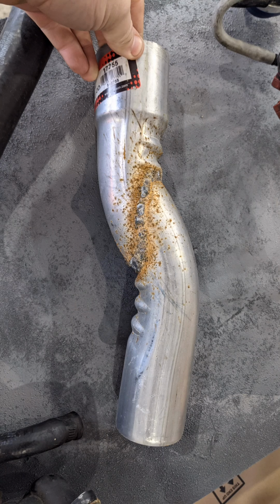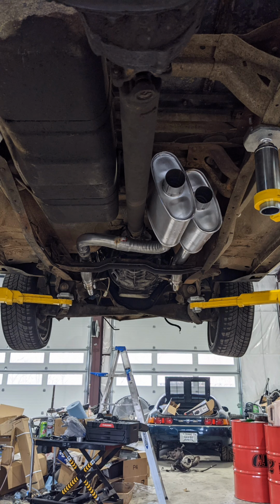All right, so I had to make some of these dog legs because the headers run straight into the crossmember. Just kind of tucks it up and over. Do a temporary exhaust for now. Once I get my suspension done, I'll get it all laid out super nice when I move the fuel tank and whatnot. So these are the mufflers I ended up with.